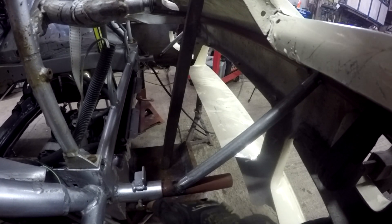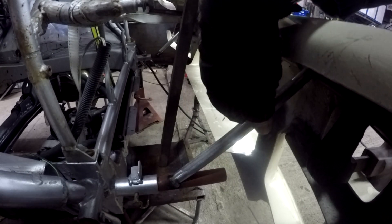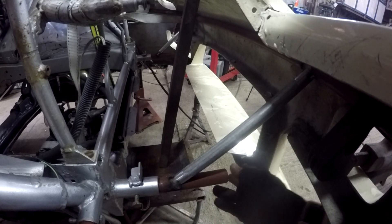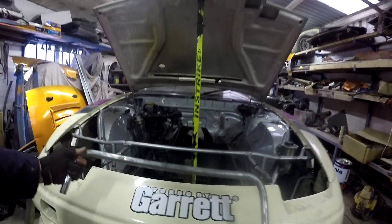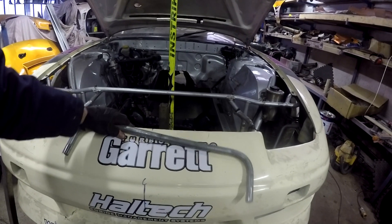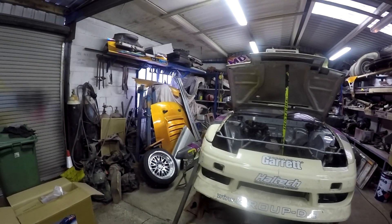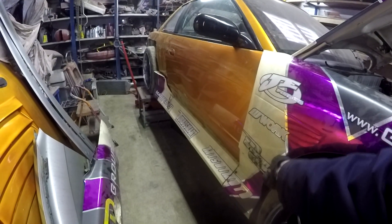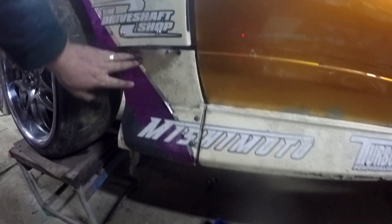You can see I've got the bar coming out of the chassis — the pin is drilled there and holding it into place — and I've got half inch tube going up, attaching to the bash bar. That's all just tack welded into place. Next step is a bit of half inch that goes down to the bottom to protect the lip of the front bumper. The second last bar is in and it goes in behind there to support the bottom of the bumper. The last bar I've just made goes in here to hold this section up, so I'll get the bonnet down, get it into position and tack it — then the bash bar is complete. After that I'm going to make up some supports to catch the wings, and the side skirts are also incorporated.